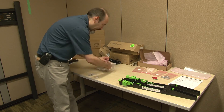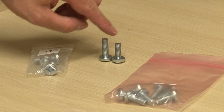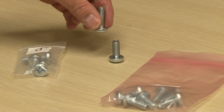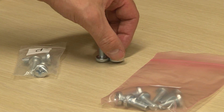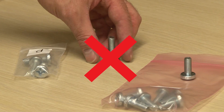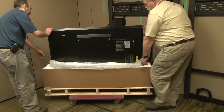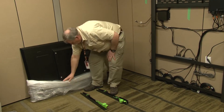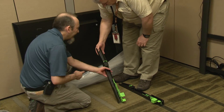Prepare the panel mounting hardware. Note that the panel mounting hardware comes with mounting bolts of a length appropriate for the G4 display models. For the G5 display models, shorter mounting bolts are provided in the system's accessory box. Be sure to use the correct length panel mounting bolts as indicated in the installation guide for your specific system model. Attach the mounting bracket to the back of the interactive display panel using the mounting hole number documented in the installation guide for your specific system model.